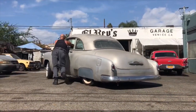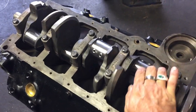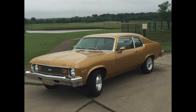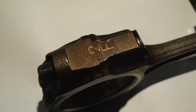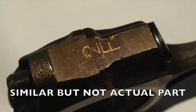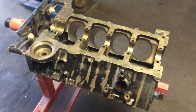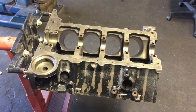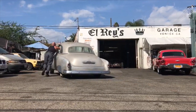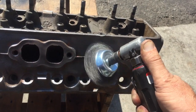After tearing down that donor engine and checking the block, research shows we have a genuine 1974 Chevy 350, two-bolt mains, originally from a Chevy Nova most likely. One tip: before removing these rods from the crank, punch the cylinder number on the cap and keep the rods and caps together — they were together before removal, they should be that way upon return. Completely stock right down to the factory size cylinder bores, this one has never been rebuilt. So we magna-fluxed the block and checked for cracks — the block was good, heads and crank were good too.